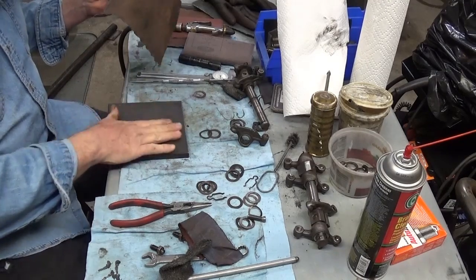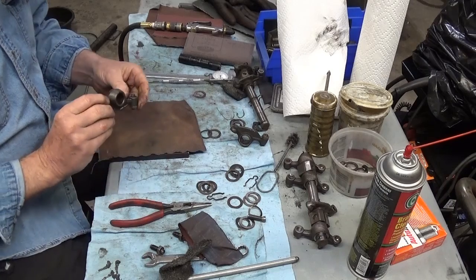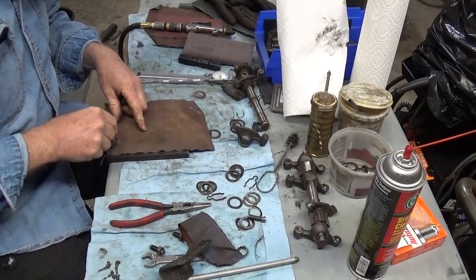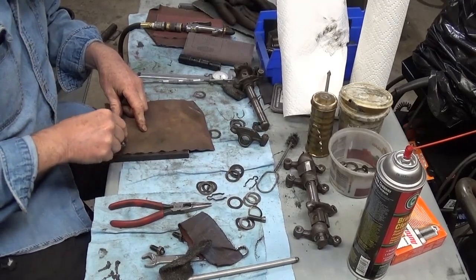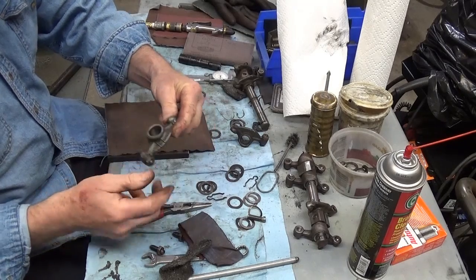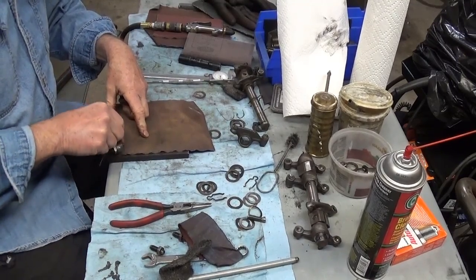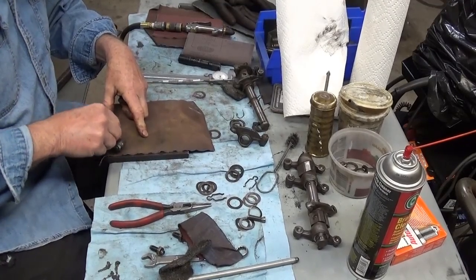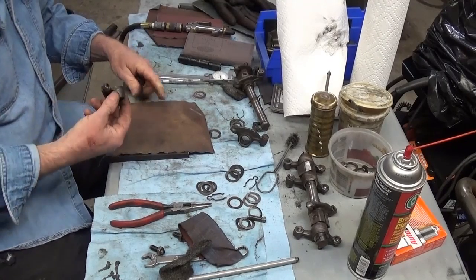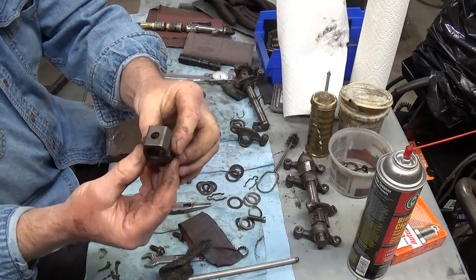I've got a piece of steel plate here, and I've got my crocus cloth here, and what I'll do is I'll take it, and it doesn't sit quite flat. I have to have one edge off of it, and I'll give it just a little fine circular motion. I'm not trying to remove metal, I'm trying to remove crud, and I'm trying to polish the end. So you can, I don't know if it shows up on that. This side here, you can see the two shiny spots, and now I'll hold it down here, and you'll feel it drag in the beginning, and then it'll start getting easier. And you probably got most of the junk off. You can start on this. Crocus cloth is fairly cheap, and it's not gonna scratch up your surfaces. If anything, it polishes them up. Makes a big difference.